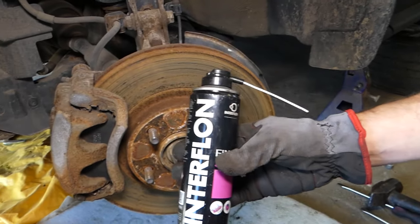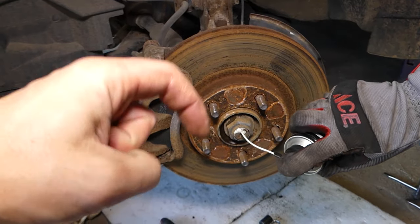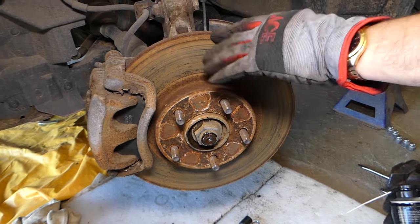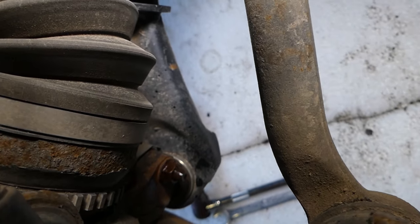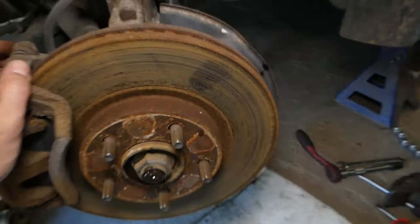Now we use some penetrating spray. All the tools and parts that we use will be listed in the description of the video below, for your convenience. Now, while we're working on that, we're going to spray this bolt right there, which is for the lower control arm, so it can soak while we're removing the nut here.